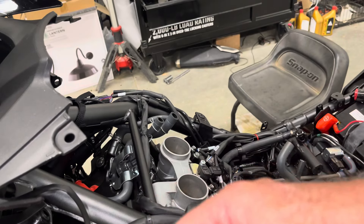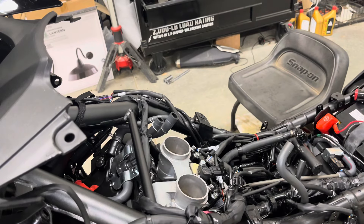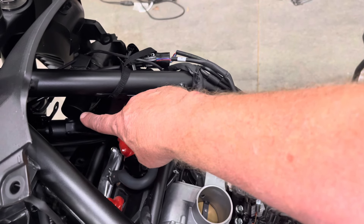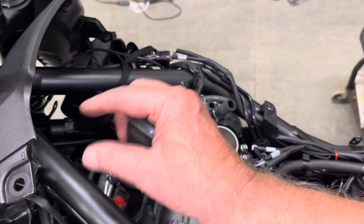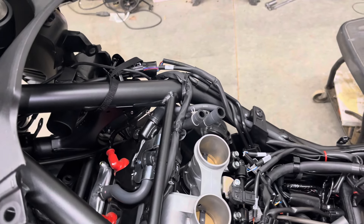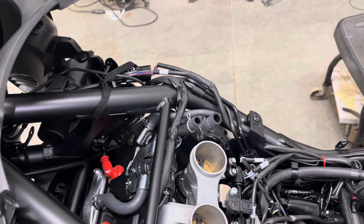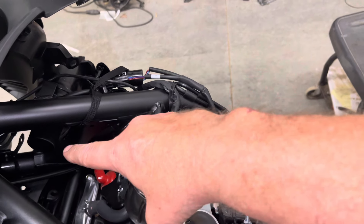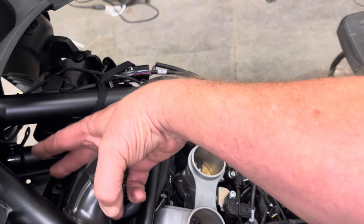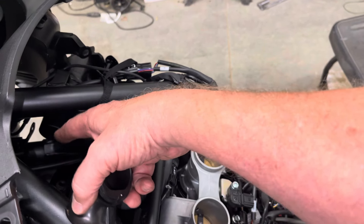So now I'm going to put the air box in there without this. I'm not even going to put the pipes to connect it, because the holes aren't that big on each side. And it doesn't do you any good unless you're flying down the road. What's it going to do for your bottom end? Zero, nothing. Now I'm going to not only have air coming through there but I've got a big open hole that's going to get air pulled all around, and it can get some coming in there on the road also.